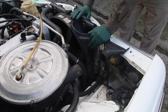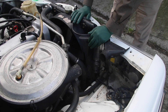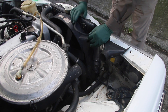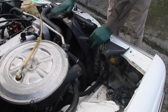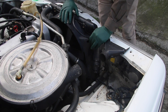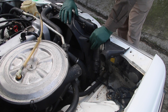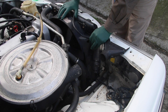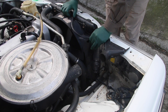If you own an older Mercedes non-turbo diesel — whether it be a 240D or a 300D, up until about 1981 — you'll notice they did not have a coolant reservoir tank in the engine compartment. They just have this hose which runs down alongside the radiator. So if you get any excess pressure or a leaking cap, coolant is going to drain right on the ground. That makes it difficult to monitor the coolant level — you literally can't open the cap when it's hot.